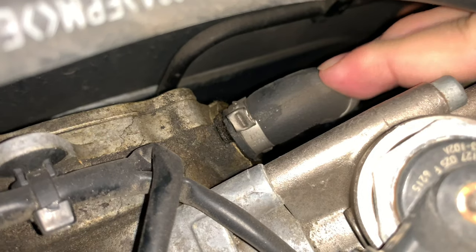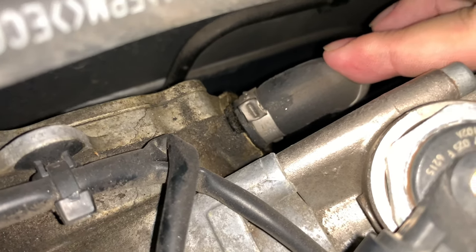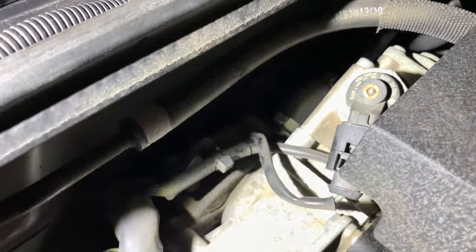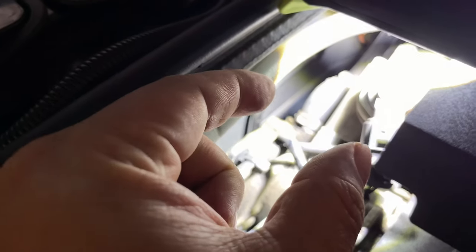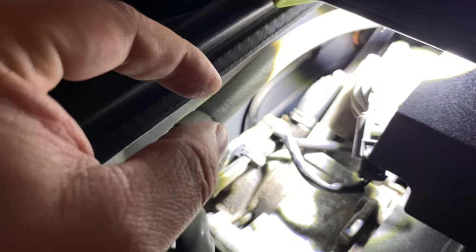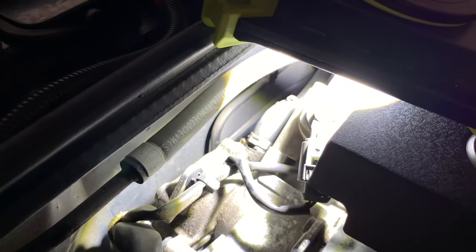The true fix is to get a new vacuum pump, and what a pain that is to replace because of where it's positioned. So to quiet this down and actually fix it — unless you really want to replace that vacuum pump — is to put a little JB Weld down here at the base to hold that in place so it doesn't bounce around. The reason it does this when it's cold is that the o-ring with its age has kind of shrunk, and when it gets cold it creates a little bit of movement.